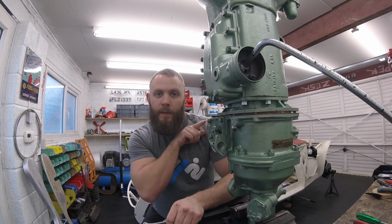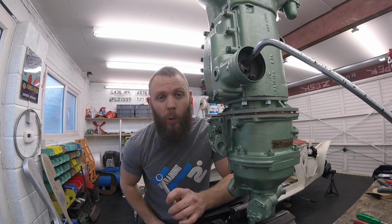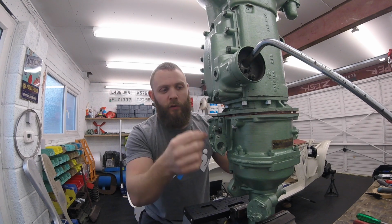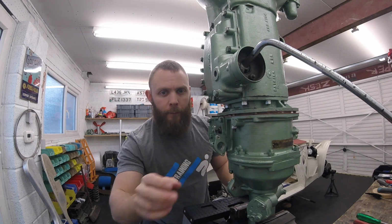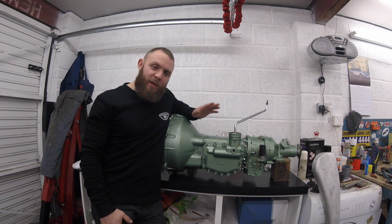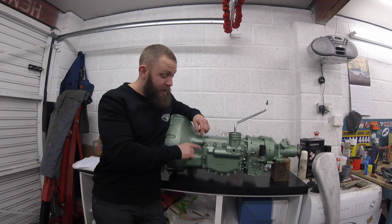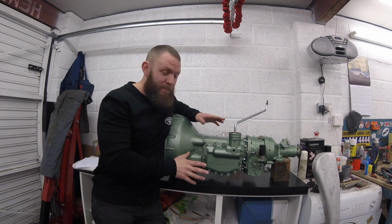We've got the oil pump plunger on the back side of the cam, and we're 1/4 of an inch away, so it's 2 flats, 2 flats, 2 flats, 2 flats until he bottoms out. Nuts and washers, whip it off, nuts and spring washers on these, job done. So that's that. Gearbox, overdrive, completed, reassembled, all the gaskets replaced, full of oil, and for now, she's bone dry. Put oil in it yesterday, come back down today, perfectly dry.